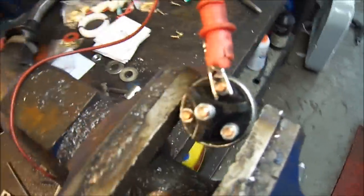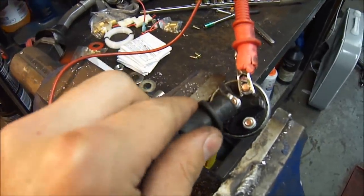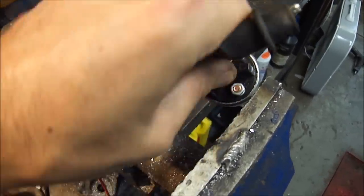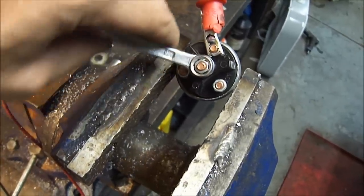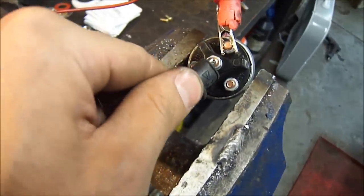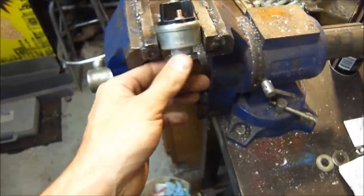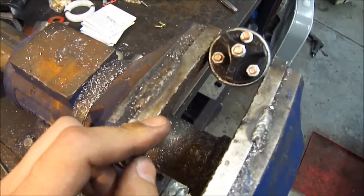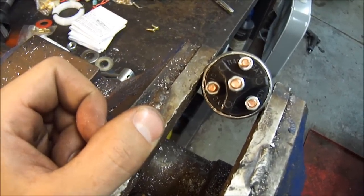So I tear it apart, go back through my wires, search it all out, disconnect it, test it — working like it should. No power to start. Tighten it — no power. All right, it's good, testing out right. Snug it up — power. So watch out for that. If you're having a problem with it cranking while you're in the on position, make sure your switch isn't faulty. I checked this one numerous times, tearing it apart and checking it — everything's right. Then snug it up because it seems right, probably tests at the factory being right, and then it shorts out.